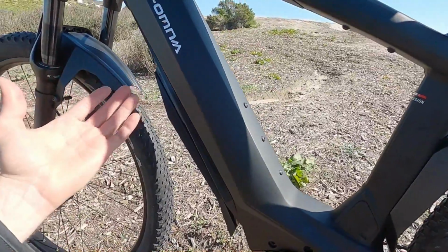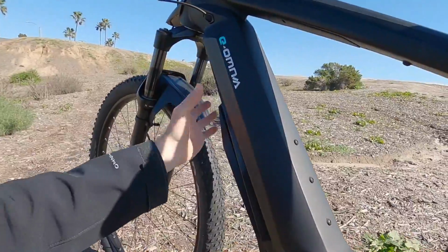Since it's high capacity, having ridden bikes like this myself at times, I feel like, okay, there's more than half the battery, I'm just going to leave it on the bike. But extreme heat and extreme cold can mess with the battery. If it gets too hot, you're going to limit the number of full charge cycles you get. It can damage the chemistry and the lithium ion cells inside. And extreme cold would temporarily stunt your range, so you'd only get like half what you normally would. And that's one reason to take the battery inside.